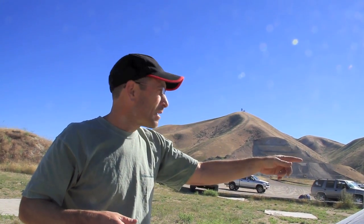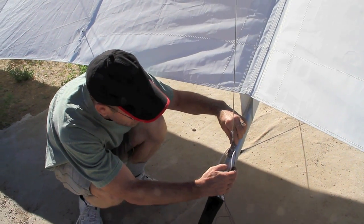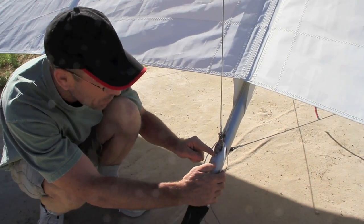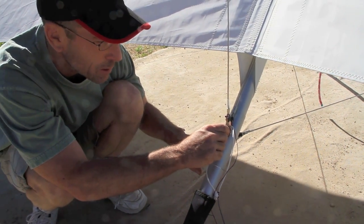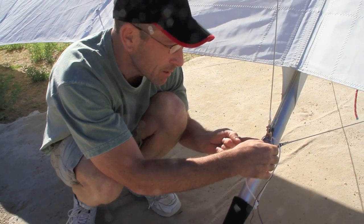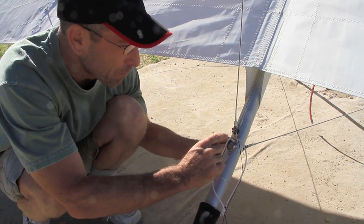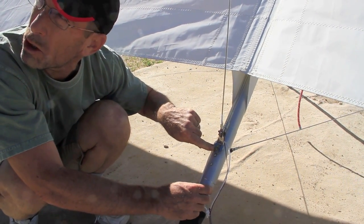If the acorn nut is missing, you need to fish around in there and find it — check whether you just lost your nut cap or if the other bolt's backing off. The wire cable goes to the crossbar — this is the top rear wire. They both go on the same keyhole bolt, one clips on before the other. These little pins prevent them from slipping off. This nut here is an inverted clinch nut, a self-locking nut, and it's pretty secure. The bolt should be clear of the nut — the clinching mechanism is in the bottom of this assembly. Always verify these are secure and that bolt thread is showing through the nut.